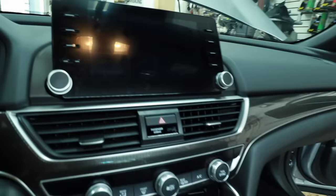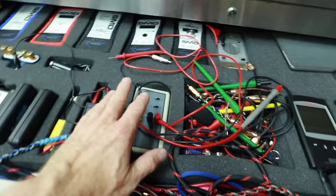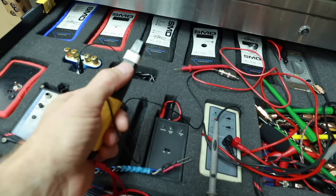To do a polarity check you need a polarity popping sound — it moves the speaker and there's a tool that will read that. We have multiple versions depending on what the car has. This car does not have a CD player and works strictly off USB because it has CarPlay, so to do our polarity test we'll use a phone with the track recorded on it. There are apps you can download, but we prefer dedicated tools. I'm a collector — I have a collection of polarity tools. The PT9A will generate a test tone both aux and over test leads and has a microphone in the tip. We have a wand style that just lights up green and red, and a Select Products version as well.